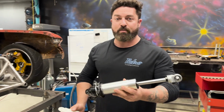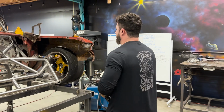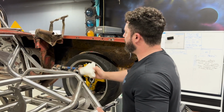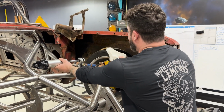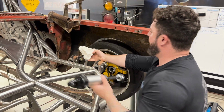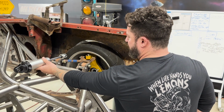I'm actually gonna put a push rod style suspension into the all-wheel drive El Camino, and I'll give you kind of a quick mock-up or a teaser for how this is gonna go in our next episode. What we're gonna be doing in the next episode is actually planning out brackets, the geometry for our Mentor Motorsports coilover. Push rod's gonna be here. We're gonna figure out all the geometry with you guys in real life, and then from there, we're gonna tie this all together so we'll have an actual rocker here to allow us to drive this coilover into a parallel location like this.